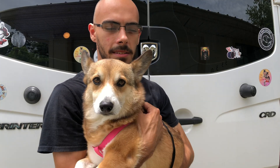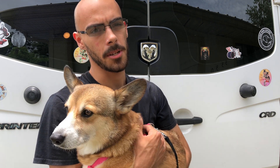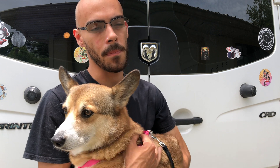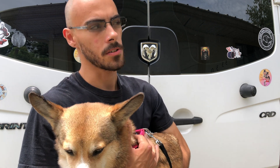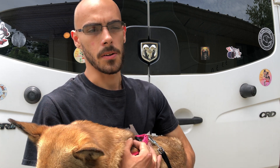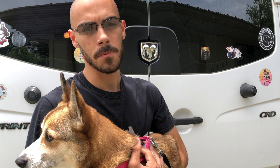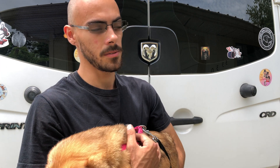So it's a new day, and today Twinkie and I are going to take the 2008 Sprinter for a test drive to verify that the DPF regen fixed the limp mode problem. I'm concerned with how quickly the filter fills back up and whether I'm still in limp mode. I'm optimistic that because I replaced the MAF, the DPF filter will perform normal regenerations and won't clog back up so quickly, but the only way to truly know is to run it and find out.